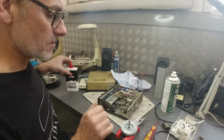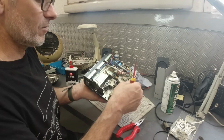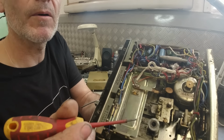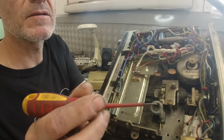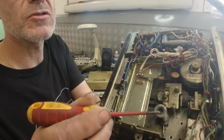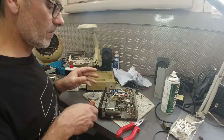And here's the tower. I'm going to put it back in a minute into its bearing. Here's the tower that holds it. I can bring this set right up to your screen to see this. This is an alloy tower, so it doesn't magnetize, because if it was steel, it would magnetize, so they've done it in alloy. There's a little bearing in there, and on the other 8-track, that bearing was loose and creating the warbling effect that we had. It came loose. So that's the tower. There's the pin at the bottom that supports the wheel. So we can put the wheel back into the tower.